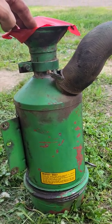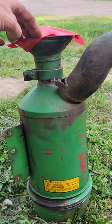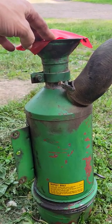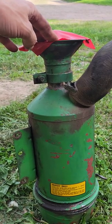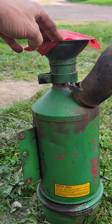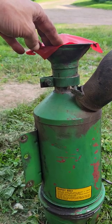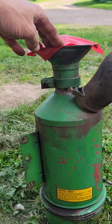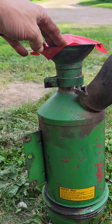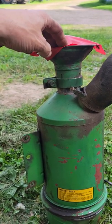These things need to be checked regularly — it says daily inspection on there. I don't think you have to do it daily, but at least once a month if you're in heavy dusty areas. If you're just doing light stuff around the house or yard, maybe once a year. Neglecting it can cause drivability problems such as smoking, poor fuel mileage, or general oil consumption.